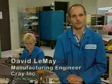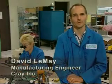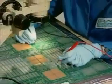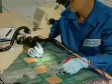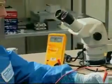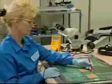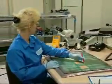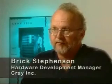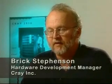When we receive boards from our printed circuit board suppliers, we perform a number of tests to ensure they meet our standards. Initially we do electrical verification to confirm impedance and other electrical attributes, and visual inspection to verify mechanical attributes. We've achieved a good balance of high-performance leading edge PC board and a very manufacturable PC board, which was key to keeping system cost down while achieving the interconnect quality required for high performance.